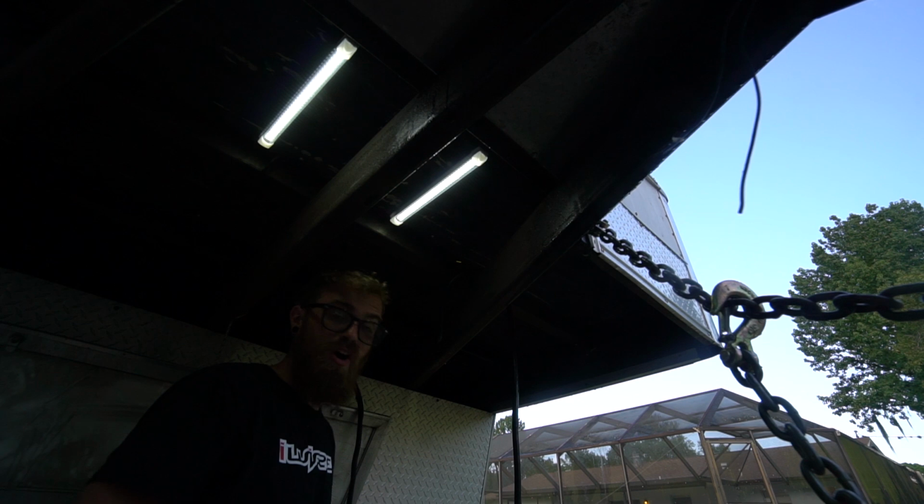We need to P-clamp our main power cable. That is important. If you ever have to self-tapper through something thick, pre-drill your holes. It's kind of tricky to find the right size bit. Not too big to where the self-tapper doesn't grab anything, but not so small that it has to drill and then you break it.